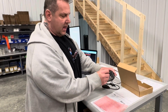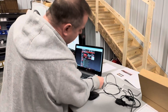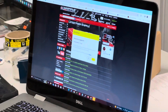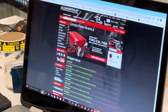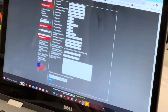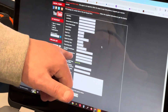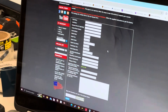Pop your SD card out of the bottom of your Tomahawk tool, take it, put it in your SD card reader. Then you go to whipplesuperchargers.com at the top — you've got customer support, calibration request. You're going to click calibration request. Some things you're going to be asked for: the year, make, model, the transmission being used, your VIN, your supercharger serial number, whether it's stage one or two, and mileage on the vehicle.